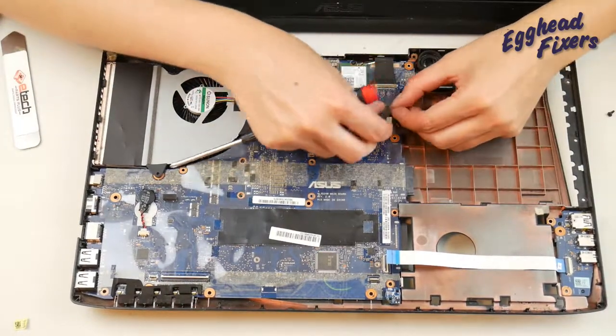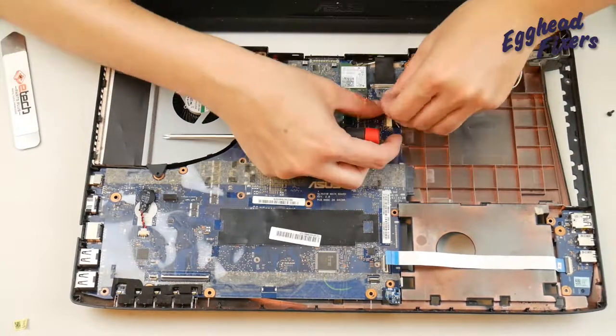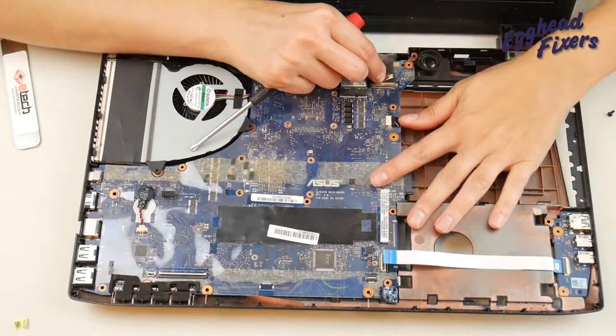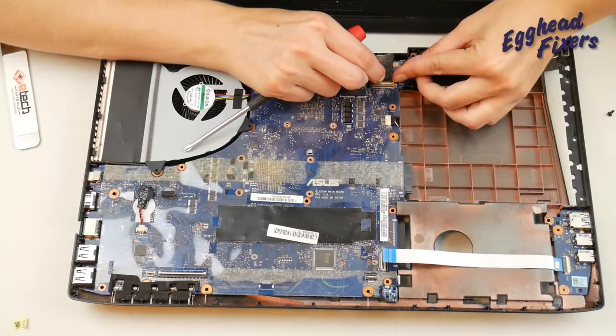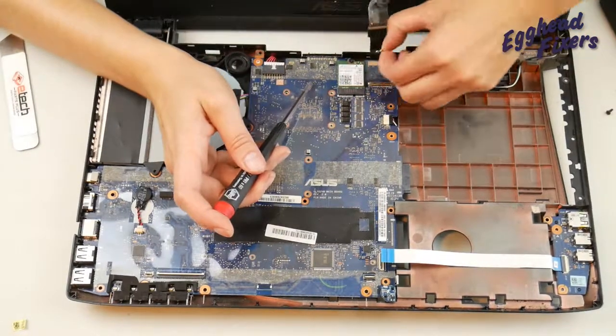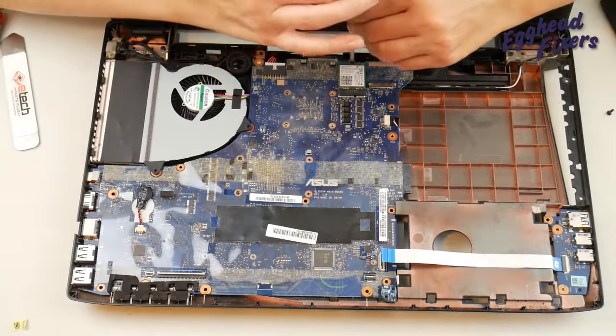The film can be really pesky. Once you get it up, pull it off, and then gently slide out that LCD cable — careful, the little metal tabs on the side help. Detach the Wi-Fi cables, and then go ahead and unscrew that screw holding down the Wi-Fi card.